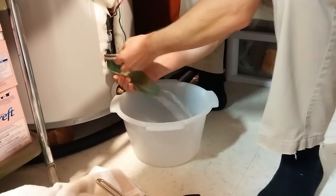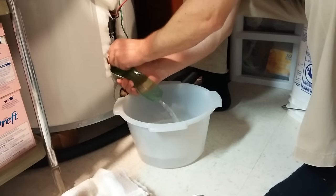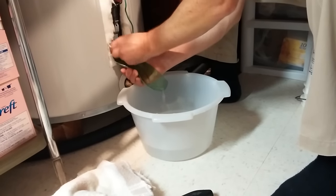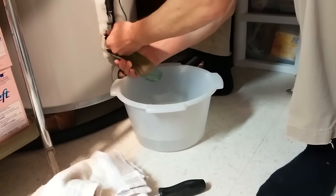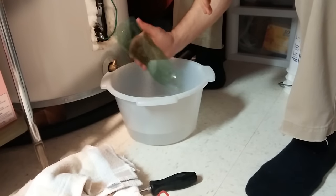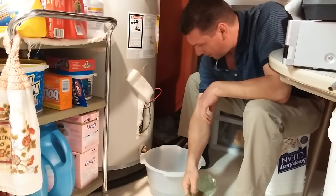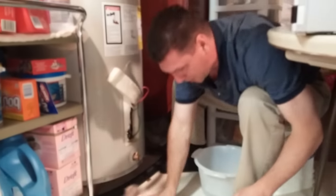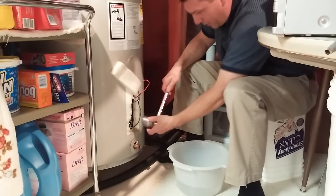Shut that sink off right now. Did you have the sink shut? That should have been done first. If you shut the sink beforehand, you have a closed system — she had the sink still open, and that would have been all over the floor. But because the bottle was here, everything went into the bucket. There's not even a teaspoon or a tablespoon of water on the floor. Element's changed, and all the water went right into there.